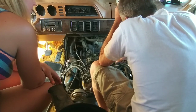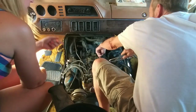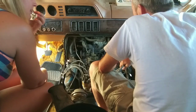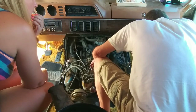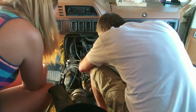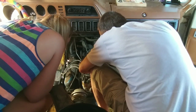But I got a funny feeling it was missing that nut on the front too. On that front corner, that's where it was missing. And then there was something stuck there, preventing the nut from going on. There's a little bit of gasket material sticking out, and it may not be the base plate gasket. It may be this gasket right in here. See this gasket? It's in between the base plate and the actual carburetor body.